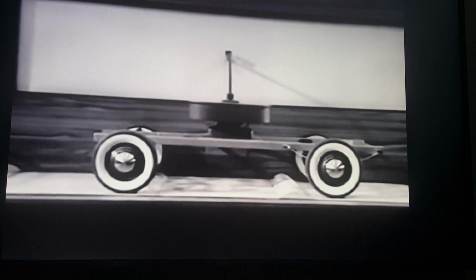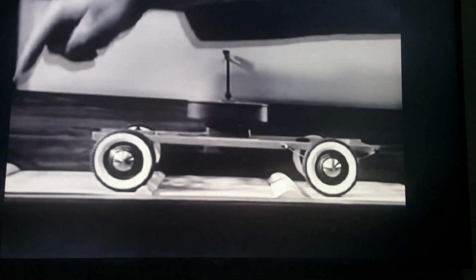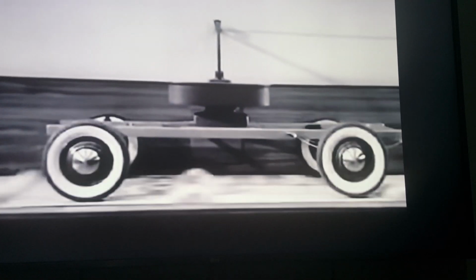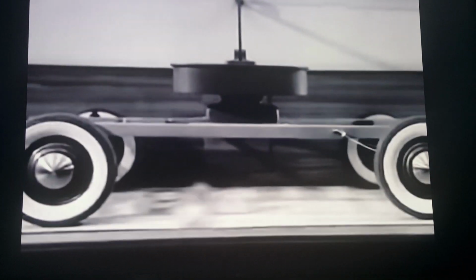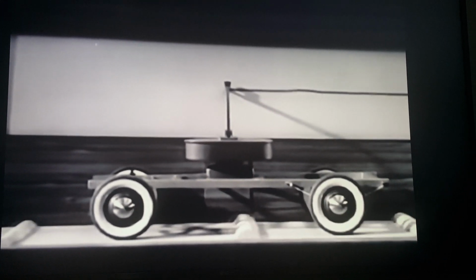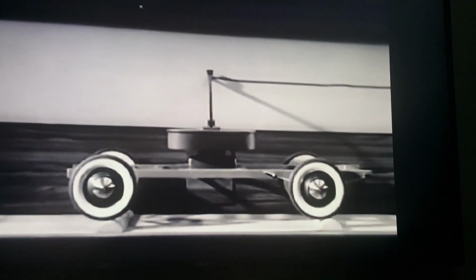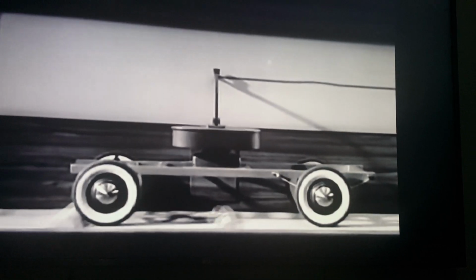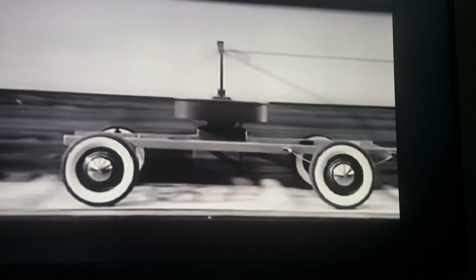We can make the severest kind of test to see whether we have a method that will really iron out the ups and downs. We'll use a lot more bumps of different sizes, and we'll run them under our wheels at full speed. Now watch the trace line. The trace line seems to be pretty smooth. Let's watch through the slow motion camera and see just what's happening. No more pitching, and the soft springs with their shock absorbers spread out the effect of any bumps that they can't completely absorb.